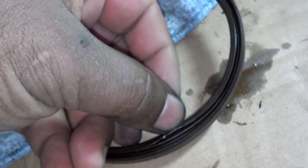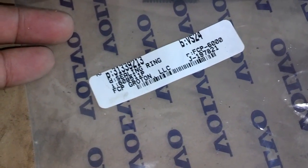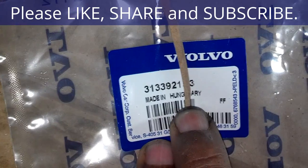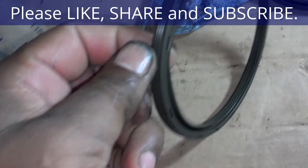The old rear main seal has basically a lip and a spring inside there that holds the seal tight against the shaft that comes out. The new style rear main seal does not have that spring, but it has several layers of ribs that can possibly keep oil back from coming through. This is the new part number for the Volvo seal — it came from FCP, Volvo wrapper, blue label, made in Hungary. This is the green seal that's going back on.